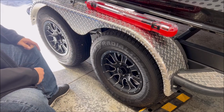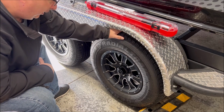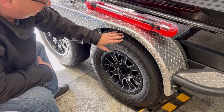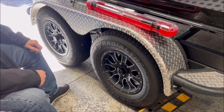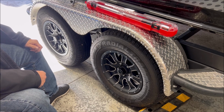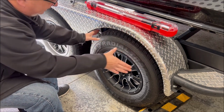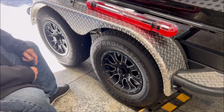One last thing I didn't mention: as you're going through and checking your tread, look at uneven wear. If you've got the inside or the outside wearing unevenly, that sometimes is a tell that you have an axle that's out of alignment, or an axle that's bent, and you need to get that fixed, because it's just going to cause excessive wear in your tires, or you may even have a blowout, because this will be slightly out of line and it's just going to wear and finally it's just going to pop, and again, it'll be a really, really bad day.